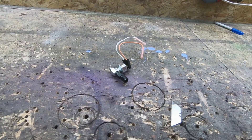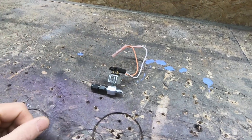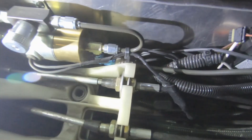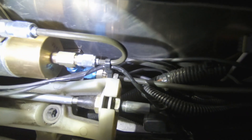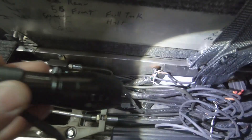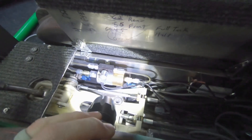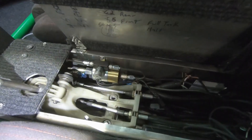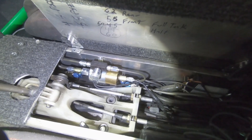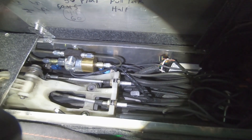And then just wired in. I'll also show you a couple things on the Holley Terminator system on how to program this in — it's already programmed but I'll just go over it to make a little bit more of a tech video. So what I'm gonna do is tee it in right there next to that blue fitting, and that is on the transmission side of this circuit. This is the clutch control valve that I installed in a previous video — I'll put the link above so you can find out more about that. So I'm gonna go ahead and install this real quick.